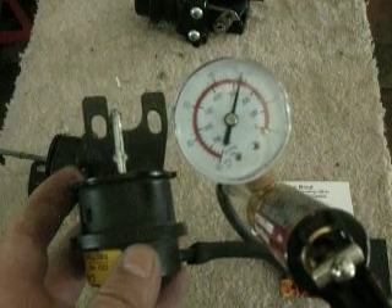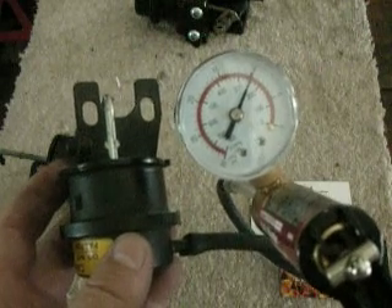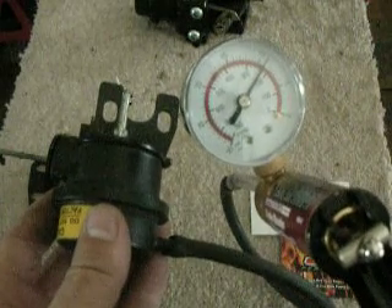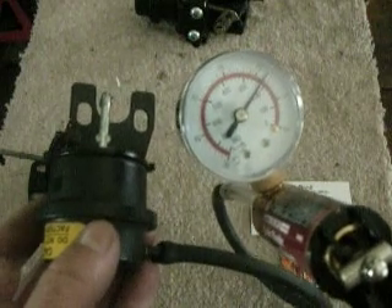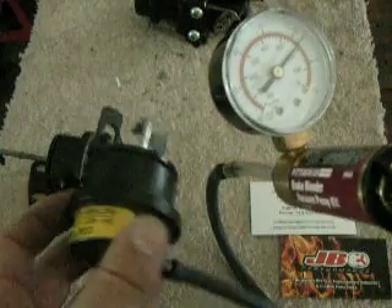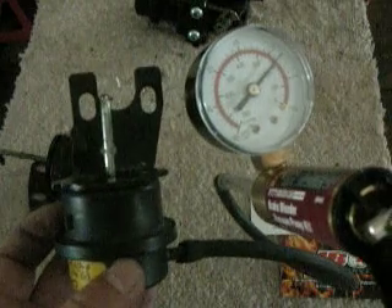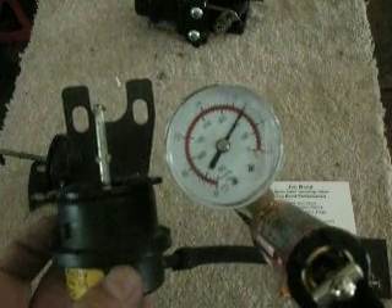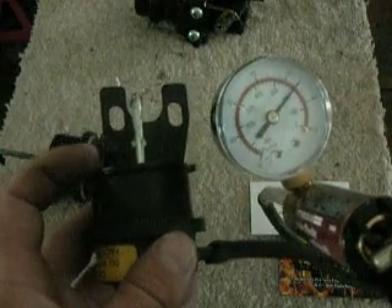If your tuner doesn't catch it, he has to tune around that and basically he'll add more fuel to your car. Then what happens is if you add something like this in later and correct the problem, you'll start having a rich condition. So it's always important when you go to tune a car that everything is just functionally working. This is obviously not a severely failed unit — most of the time you can't even draw on it. You can see this unit continues to drop, and on a car it will still work, so you'd look under the hood and say the valve's working — but in essence it's actually no good.